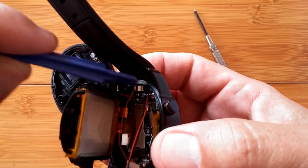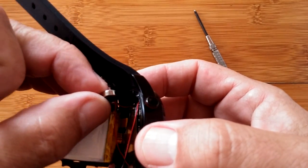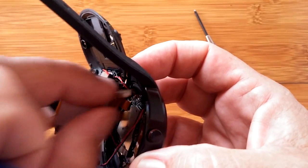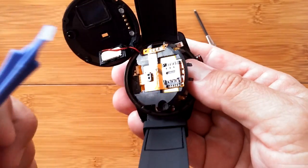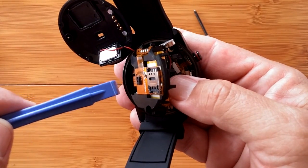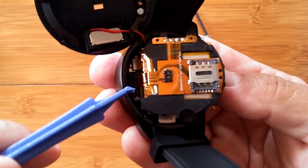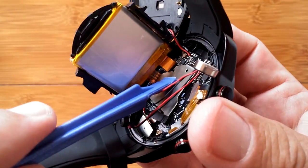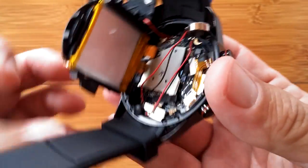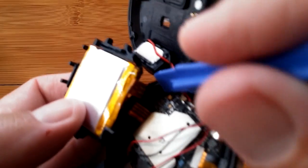There's what looks like a button battery, but that's actually the haptic feedback motor — the little vibration thing that will cause it to vibrate on your arm. So we've got these two straggling things, then the battery here underneath the motherboard itself. The thing we always want to look for when we take a watch apart — whether you're going to flash it with new firmware or it's stuck in a boot loop — is to unplug the battery. You can see way down here that little connection right there. We want to pop that little connector up. The good ones sit in a connector so you can replace the battery pretty easily. There we go — it just popped right off.